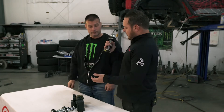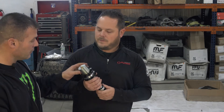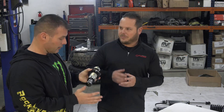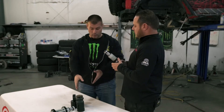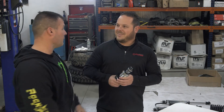If you've got this set up wrong, you come down, blow through it, and it's going to collapse and hit hard. When it engages is critical — when this is engaging, just like any other bump stop, your spring rate is going up. You'll see some setups with this almost engaging in active suspension right off the bat, constantly in the bump stop the whole time — making noise and jacking your spring rate, giving you a very rough street ride. You want this to come into play only when you need it, only towards the greater extent of your suspension travel.